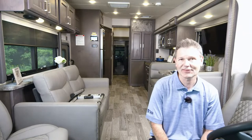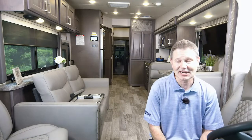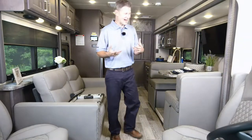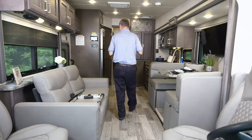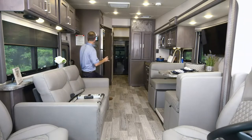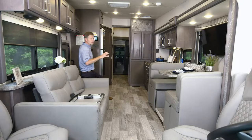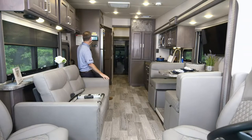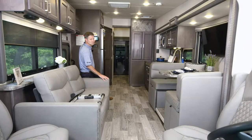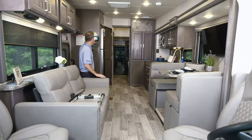There is a lot of storage on the outside. I'm going to put the walls back in to make it easier to show you the bays. Remember, when putting the walls in, have your engine on and parking brake set. We'll go ahead and put in the bed slide first — it gives you a warning asking if your Tilt-A-View bed is up. As the walls come in, here's a quick tip: if the walls start coming in unevenly — one side faster than the other — that just needs to be re-synced.